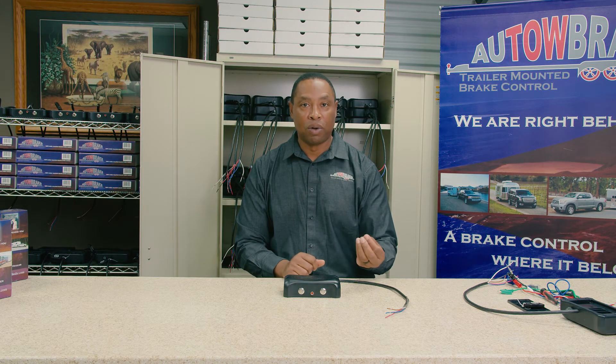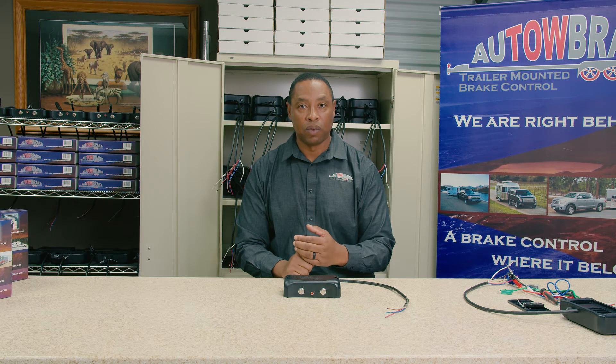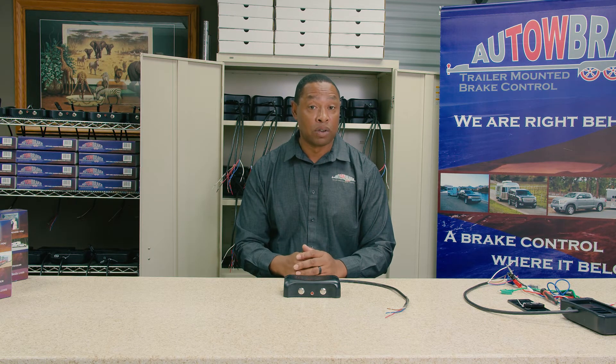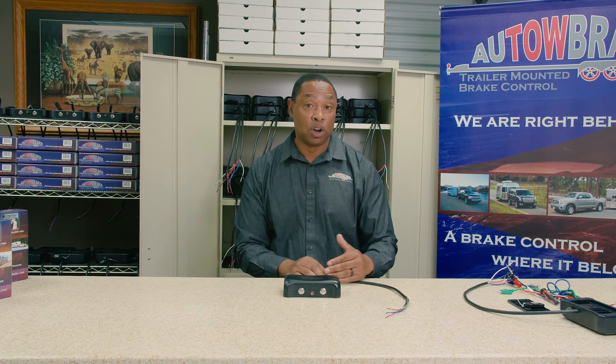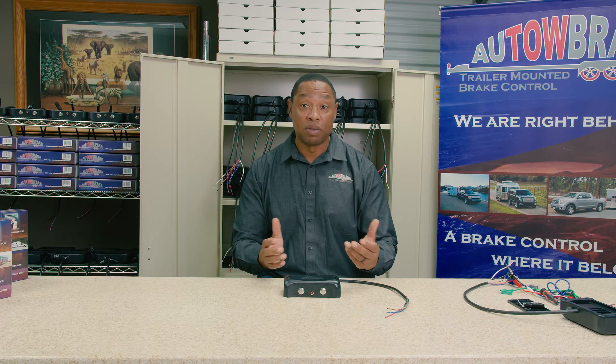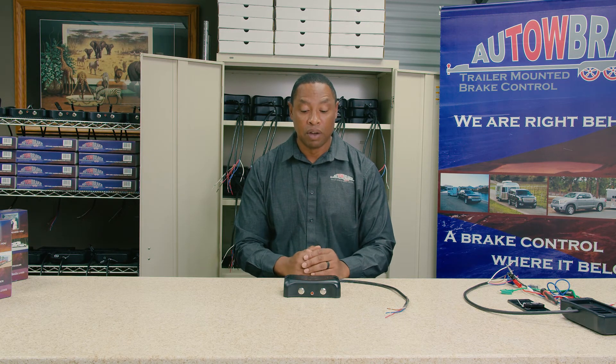Once you've established the correct voltages, retry that again. Nine times out of ten, it's usually wiring — wires in the wrong place. We get a lot of customers who have a yellow wire and a green wire instead of red and brown, and they don't wire it correctly. Also, when customers start looking at the trailer wires, there might be a short or some kinking going on. So these are the kinds of things to check there.